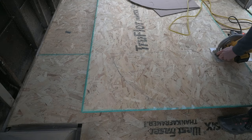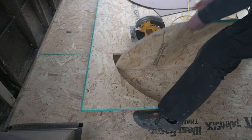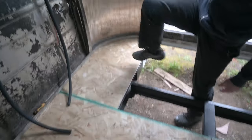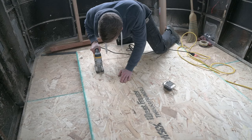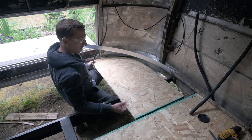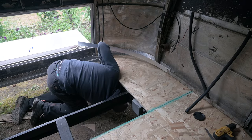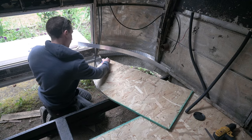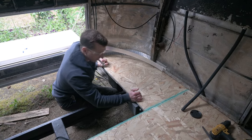Because of the tongue and groove in this OSB subfloor and also because it was the last piece going in, I decided I had to cut it into three pieces to be able to fit it in — I had no room to maneuver otherwise. I did notice that on the corners, because the skirting bends in so steeply, the cardboard template fit really well but the three-quarter-inch subfloor did not fit as well because the bottom edge was hitting the inside face of the skirting.